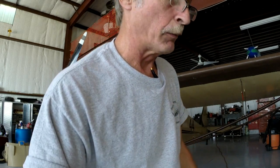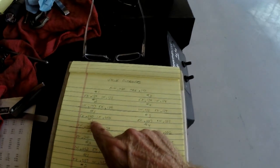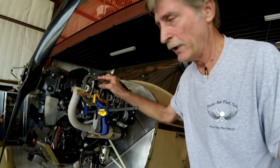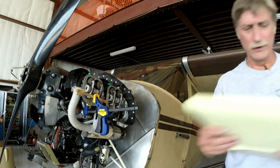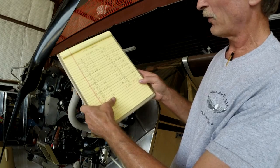You'll see the combination of numbers I began coming up with after I changed over from the short pushrods. I wound up with numbers of .040, .050, .027, .023, .050, .029, and .006 - that last one was a really tough one to overcome. To fix that, I systematically removed each pushrod and each rocker arm, switching them from cylinder to cylinder until I found I had a fat one and a short one. Then I started switching combinations of pushrods and rocker arms until I got the right combination. Now all my clearances are .040, .052, .045, .045, .057, .040, .036, and .038.